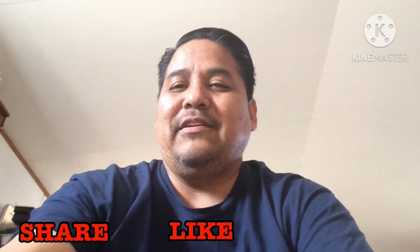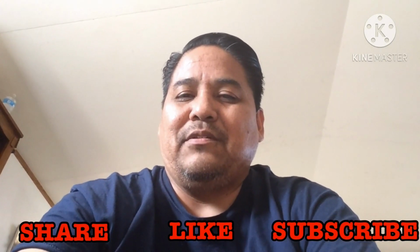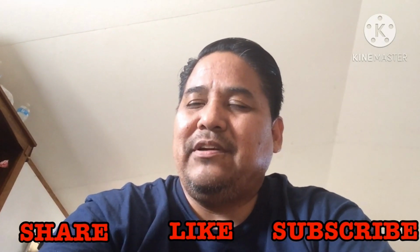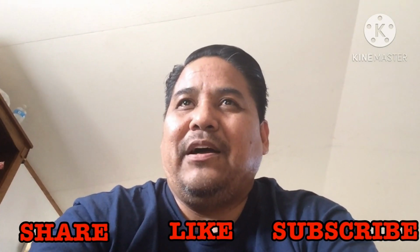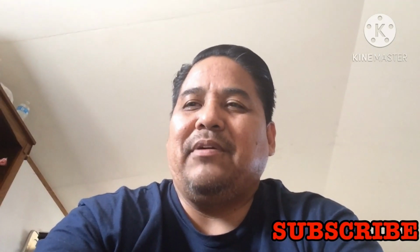Okay, YouTube, there you go. The fan is working and I just need to do some more troubleshooting. So far I replaced the resistor, the low fan resistor, and also checked the fuses. I checked the relays, the high fan relay, and the fan fuse, and they all check out okay, they pass. And I replaced the thermostat, and that one is working.